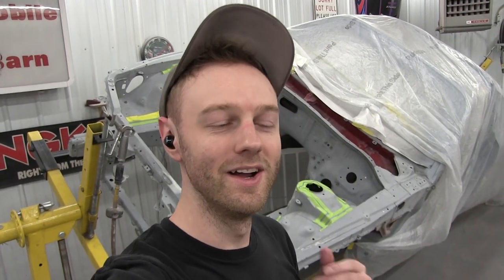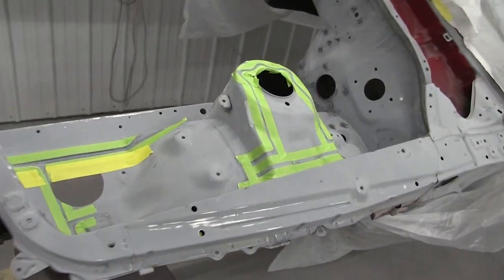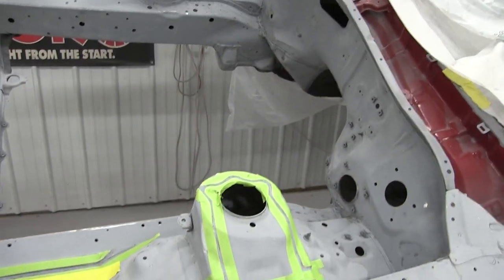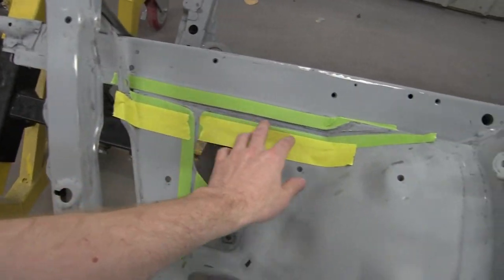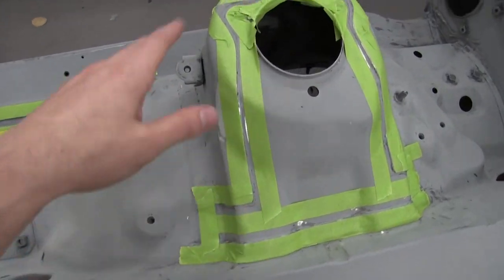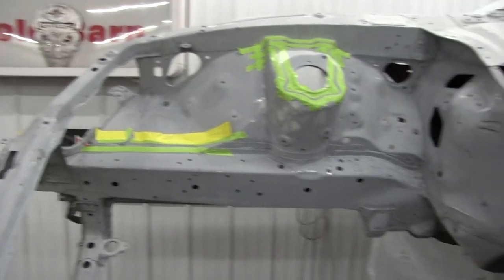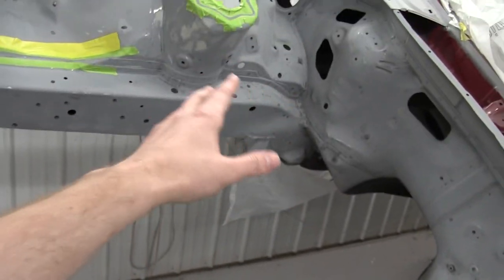All right, so I got a crazy amount of time in sanding this. It's not fully sanded out yet. There's still like a few spots in the corners to go, but you know, that can wait for a second. But what I'm doing now is I got the seams taped off. I'm gonna add one more coat of seam sealer, just a nice flow coat, just so it flows out and looks a little smoother. And then we should be ready to go for high build primer after I get the little corners and stuff like finalized sanding. But it's looking pretty good.